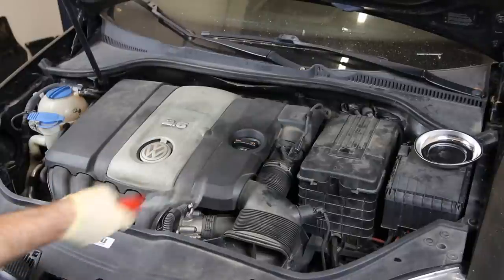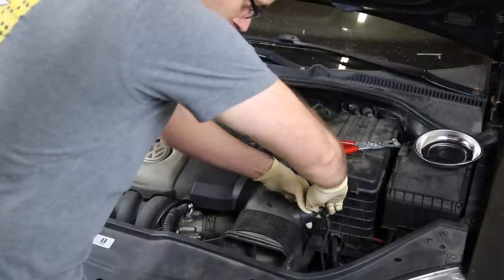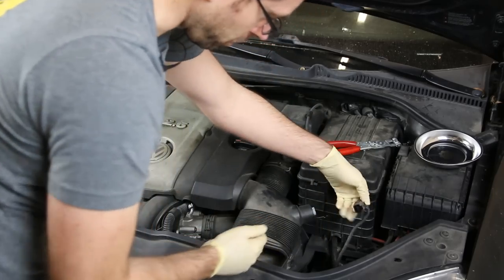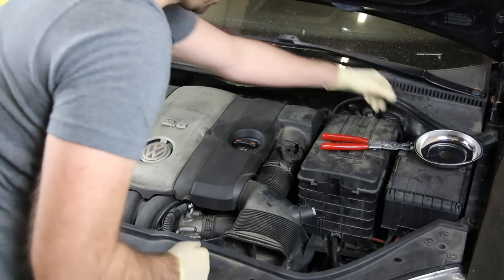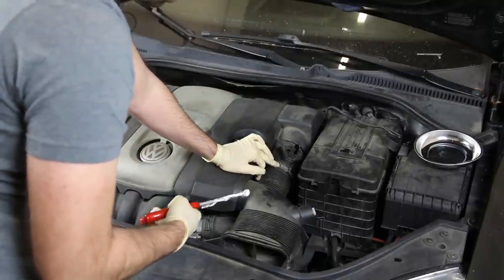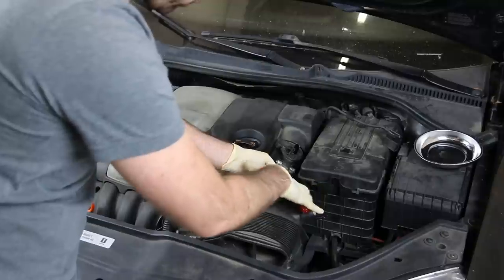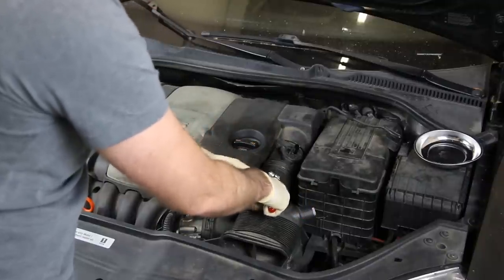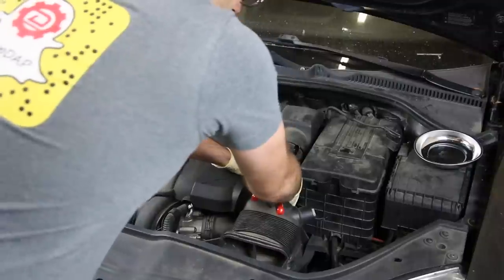Here we are under the hood of our 2.5. We are going to start by removing our engine cover. This is the air filter on this vehicle. We're going to start by disconnecting this sensor here — you just push back on this tab right here and then pull past there. We'll do the same thing with this sensor, which is the mass airflow sensor; the connector is on the other side. Now we have our spring clamp here. You can use regular pliers on this, but this is tough to actually take off without spring clamp pliers like this. I'll have links to our version of these pliers in the description. Basically it hooks around one side with a circle that hooks on the other side so that it's easy to get on and off. Then you can just slide this clamp down, and there's also a lock in place here that allows this hose to slide back off the engine cover.